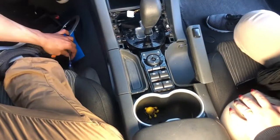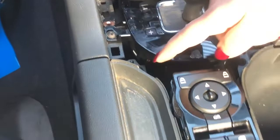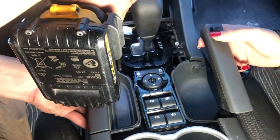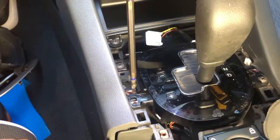Now we've taken the trim off, I want to show you which screws to take off. If you look here there's one screw here, two, three, four, five, six, seven, eight, nine, and there's one right underneath — that's ten. In our car at the moment two screws are missing which they're meant to be there, but in your car they'll all be there for you to take off.